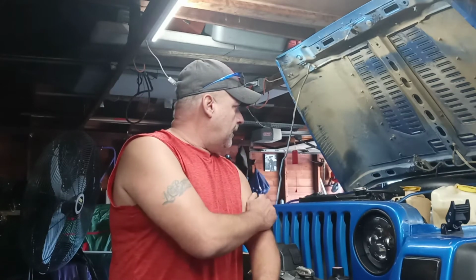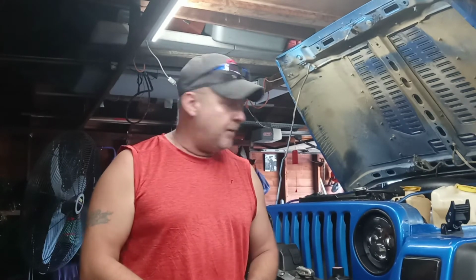Make sure you prime your oil pump before you start. I've read somewhere that people do it without priming a pump. I do not recommend that whatsoever. Supposedly it pumps up super quick if you just crank it, but I do not recommend that.